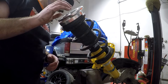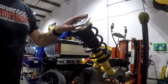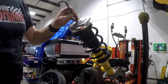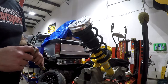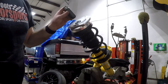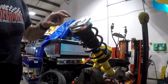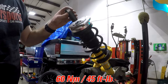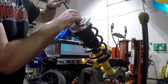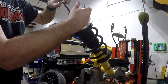I'm ready to torque the new nut onto the strut. There is, at least on the Bilstein, a 7 millimeter hex Allen key that you can use to hold it — you're going to need something like vice grips to hold the Allen key because it's going to take a fair amount of counter-torque. The nut itself is a 21 millimeter. You're going to either need a pass-through socket or a crow foot wrench. The torque spec is 60 Newton meters. I'm going to go ahead and use the hold feature here and a torque wrench to tighten this down to 60 Newton meters. While you're doing this, make sure that your top mount does not rotate off of that alignment.